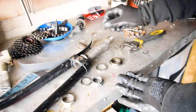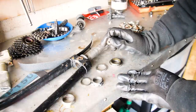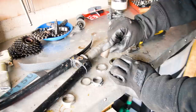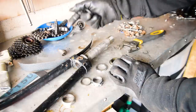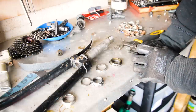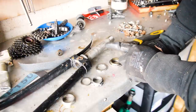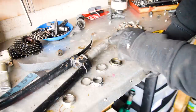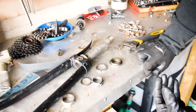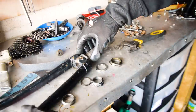So here's something interesting. The bike came with a stem already in there. What I noticed was there was this wedge that was stuck in there as well, so I had to get that out. But that meant I then could drop the stem all the way down, but I couldn't do it. The forks were a little bit stiff coming out. They wouldn't drop straight out when I undid the top nut. I had to actually pull them out.